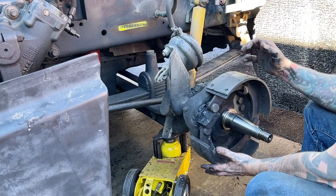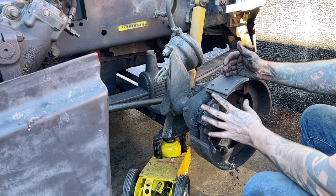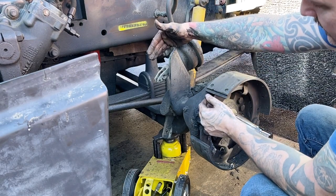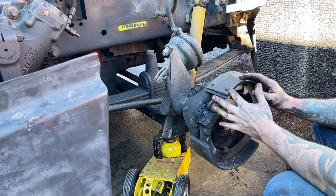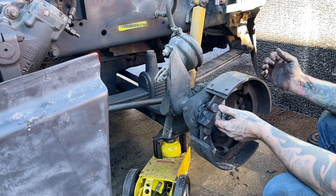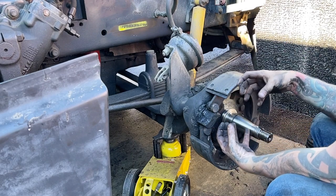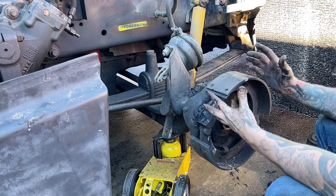Heat causes iron to expand. So as these brakes apply friction to stop, it creates a lot of heat, transfers that braking energy into heat, and that heat causes that drum to swell and make the hole bigger. So the brakes lose effectiveness because the stroke that's involved in pushing these out is shorter than the drum gets bigger. Now, there's a couple ways to combat that. One is buy high quality drums made with high quality steels that limit the amount that the drum will actually grow and the rate the drum grows. And two, use a longer stroke capability in your chamber, which, as the drum size increases, the brakes expand due to the longer travel of the stroke and keeps the brakes in contact with the drum longer.